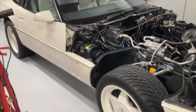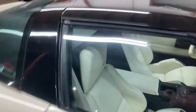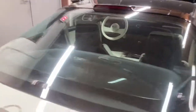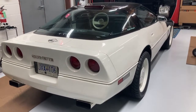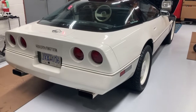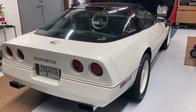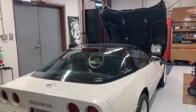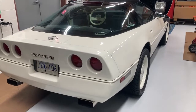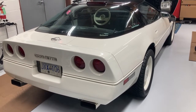I have several Callaways, and this car is not quite as fast as the modified Callaway that I have, but it's there. It's definitely quicker than a 1990 to 1995 ZR1, and top speed — actually it's faster, because we changed the overdrive ratio. This car has hit the 200-mph range. We have a 0.68 overdrive in this car, which is the less-steep overdrive — that's the Z51 overdrive. All of the 35th anniversary cars were never offered in Z51; they came with the Z52 option only, but we've got pretty much all the Z51 parts in this car.